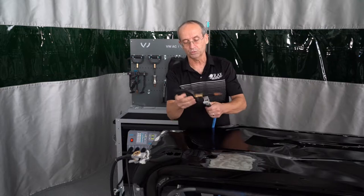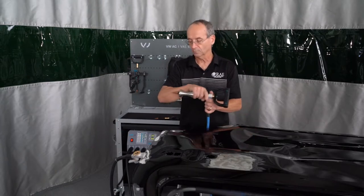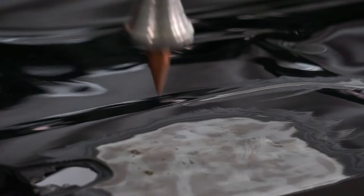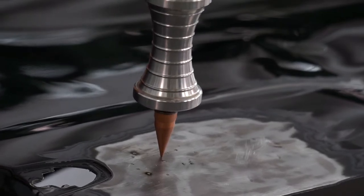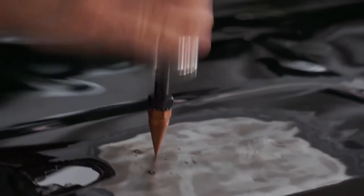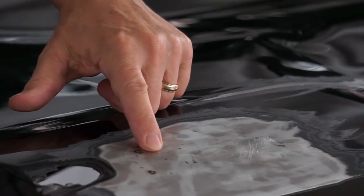Part of the other easy tools that we have is the little handheld one. We also have a slide hammer one — and this one, you can see in the picture, has not had any burn on it yet, so this is a brand new tip. When we go to put this on the panel, it'll weld on. I'm going to do it a couple of times and then at this point we actually have some steel residue building up on the tip so it's actually going to weld on better. Very, very cold weld going on it, but yet it really holds on good.